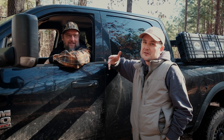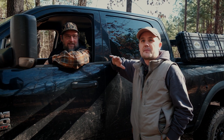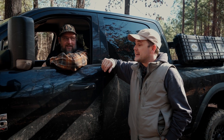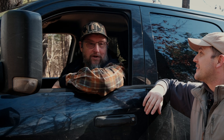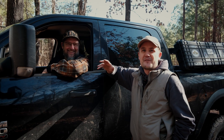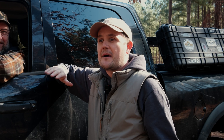To put some numbers to this: my ZR2 is about 4,700 pounds from the factory, plus a couple hundred pounds of stuff with the tent, topper, and bedside. Matt's is over 9,000 pounds factory, and at least a couple hundred more pounds of stuff, and they're on the same six-ply E-rated tires. So let's see how his street pressure — 65 PSI in the winter on what is definitely not a Tonka toy — compares. That's over double mine. We're going to run over the rocks at 65 PSI street pressure, then half that, which is approximately my street pressure, and then down close to my mid-grade PSI to see how the tire reacts.